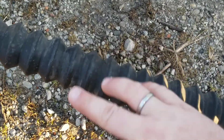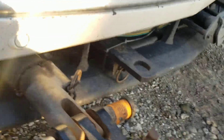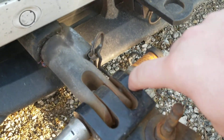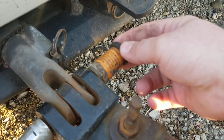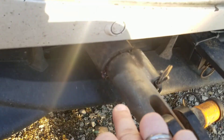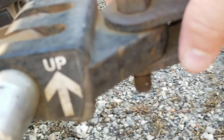You can buy every piece of this, which is nice. These are the original boots, which is amazing because I've hit a lot of animals — I even hit a super-single tire from a semi and it saved the front end. This car is basically scrap when I'm done with it anyway. This pin is totally shot and there's a ton of wiggle — you're supposed to have some wiggle there, that's fine. These Blue Ox lock things are totally worthless; the balls on the inside freeze up. I leave it on there so nobody steals it, and I leave that one so I can still hinge it around.